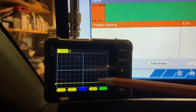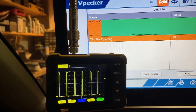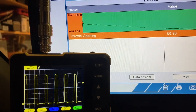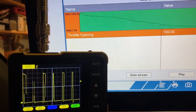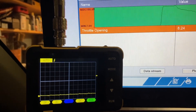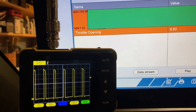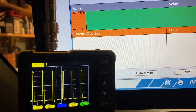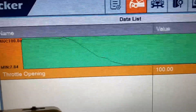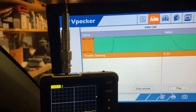When I release the pedal the open-side pulses basically completely disappear — what you're not seeing is that the signal has been toggled over to the other side of the motor. It's single-channel operation so I can only show you one side at a time. Just off the electronic idle stop — not physical stop — and ramping it open you can see on the graph in the background the throttle is actually opening. When released completely the open signal is gone; there is a closed signal there but we can't see it in single-channel mode.